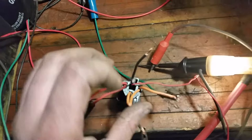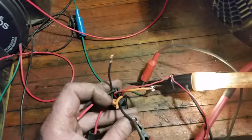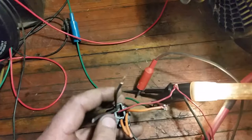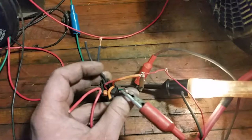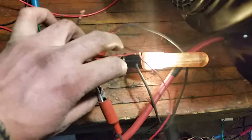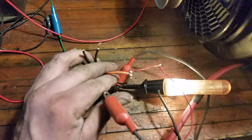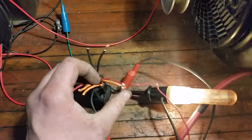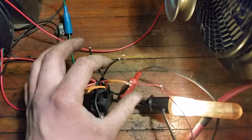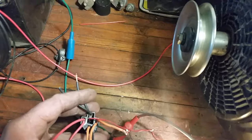What's going to happen is we only have continuity between the center prong and the bottom prong when the switch is in the neutral, off position. Now when the switch comes on, we have continuity from the top terminal — these two wires — down to the bottom terminal, the same wire going out to our relay. And then we cut our power coming from the key switch. When the switch is activated, we'll have continuity between this wire and the fuel shutoff relay. What I'm going to do is hook this starter signal wire to another power wire going to the relay. So when the starter is activated, it closes the switch and then the power is able to run from a separate terminal on this relay. I'll go into more detail when I unplug this.